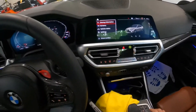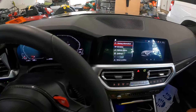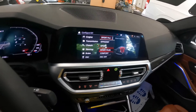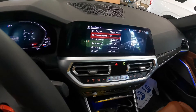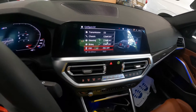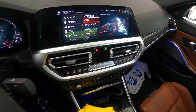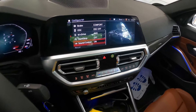We're going to go over programming the M1 — I have mine set up for the first one, which I would consider my kill mode. For the engine: Sport Plus. You can see there's Sport Plus, Sport, and Efficient. Transmission D3, which is the firmest shift setting. All these in comfort. Sport — I really think this is the setup that's going to give me the best 60-foot traction control off, obviously. I put the four-wheel drive in 50-50, not the Sport. The Sport is 80% rear, 20 to the front.